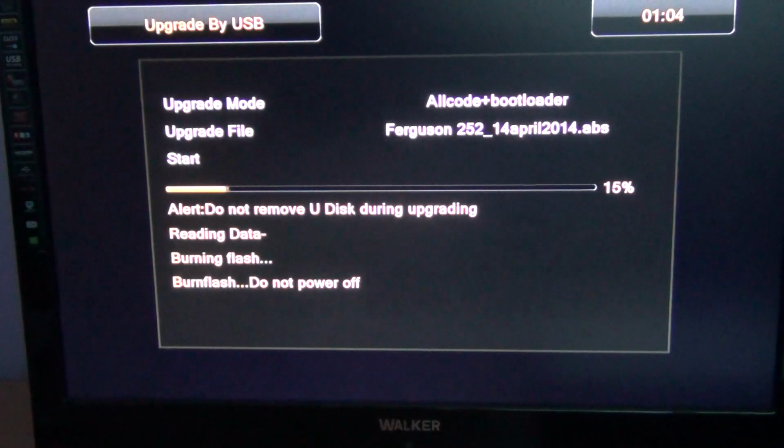So why it's handy to do this really is if you were to buy the box un-pre-programmed and you were to perform a full satellite auto scan, you could end up bringing in something like 400 TV channels or something in that region, and basically they'll come in what appears to the average user to be a random order. And what you'd have to do then is sort them into the order you wanted, deleting the ones you didn't want, like regional variations and maybe some channels you don't want and things like that.